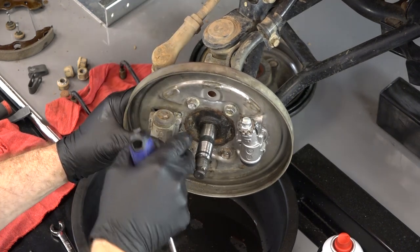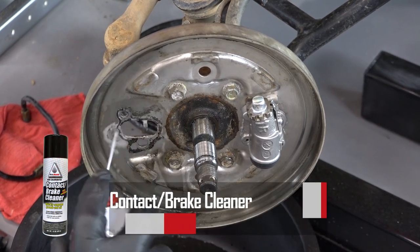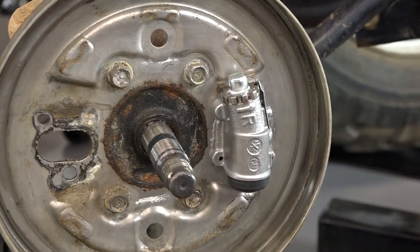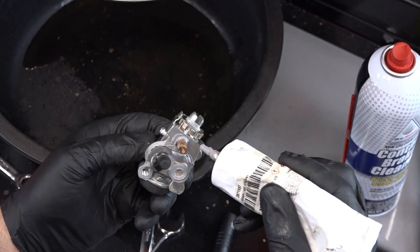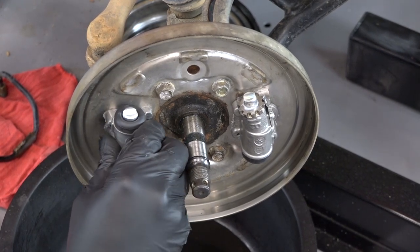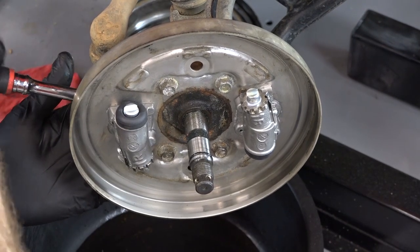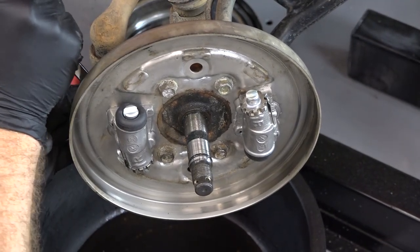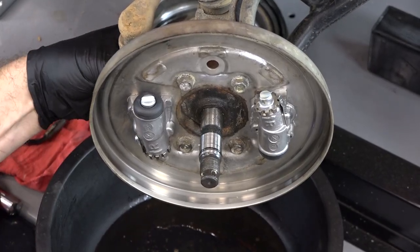Why would you really need to replace one of these? There are a couple of reasons. What typically happens is we get a lot of water into this and then it rusts everything up to where you can't even adjust it anymore. The other thing that happens is if you don't bleed your braking system often enough, it'll actually bring water into the system because brake fluid is hygroscopic — that means it attracts water. Water gets into the system, works its way down to these little cylinders with the pistons in there, starts to rust, seizes them up, and then they don't operate anymore. Now Honda makes a rebuild kit for these, but for the cost versus the amount of effort it would take to rebuild these little guys, it was easier just to replace them.